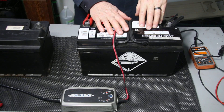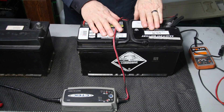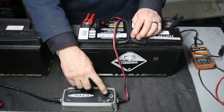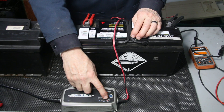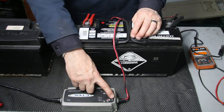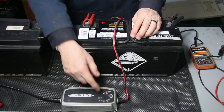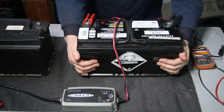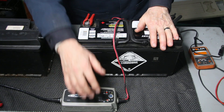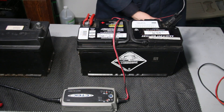It's 6 p.m. and I thought I would stop by and check in on the AGM battery. Looking at my CTEK charger — it's jumped to the second indicator light. That's a really good sign. I've learned with this charger that if it stays down on the first indicator light, it'll eventually trip out and show an error message. But this is moving up on the charge. I'm feeling the battery — it's not cold, not hot either. The CTEK charger is warm.